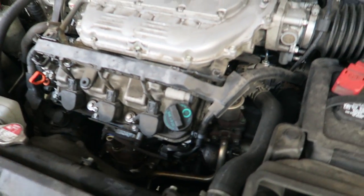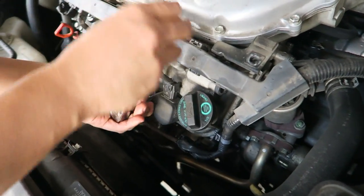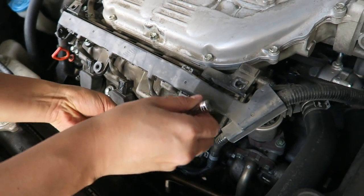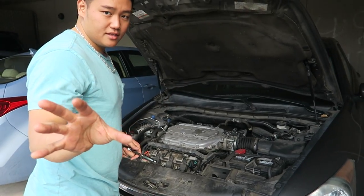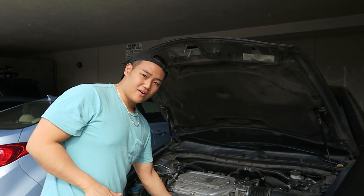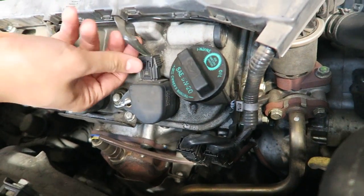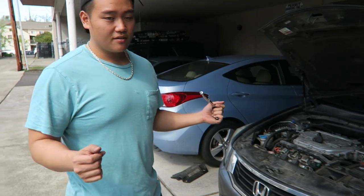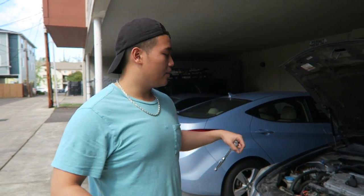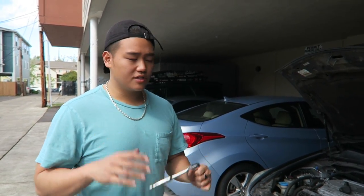Next step, take the cover off. The nut's off. Before anything — first step actually should have been to take the power off. I would suggest taking it all off. You press on the button right here and then you push and pull. There's one. The plug's out and it's pretty simple — it's a latch, press it, pull it out. Get all six of them out. Make sure you take them out even if you change just one spark plug, just to be safe. Better safe than sorry.